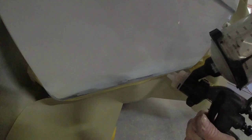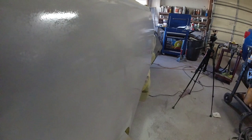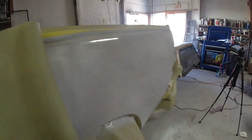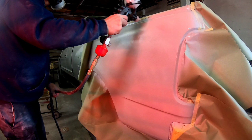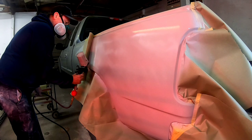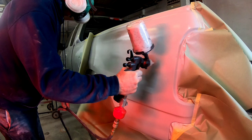If you look at this primer in the light, you can start to see how it's flashing off and starting to dry. We want to make sure it dries really well before we put our second coat on. I'm going to put my infrared light on it and let it cure up a bit, and now we're going to apply our second coat of primer. If you can let it sit for a couple of days before you sand it, that's good — it allows the primer to shrink if it's going to shrink at all, cure properly, and you won't have any issues when you put your base coat and clear coat on. All we need to do is block this out and paint it.